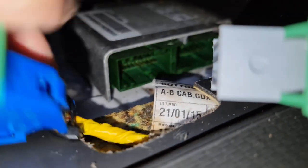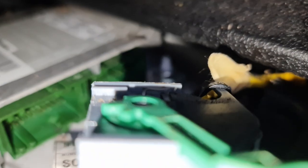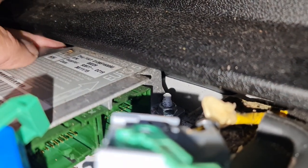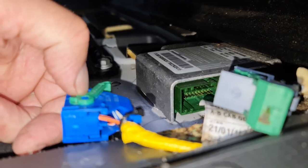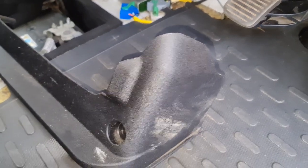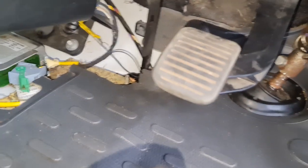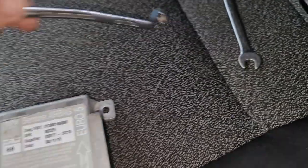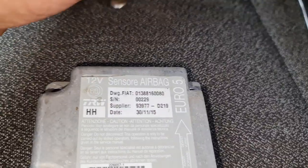There we go. It looks like a 12mm or 10mm - you can see one at the back and one this side, so you've got three to get out. Two screws one each side - take them out. It takes a little bit of easing but it does come out, and that makes the module much easier to get to. Three screws, 10mm spanner - you want a long-reach gooseneck to get to that last one, but apart from that it's okay.